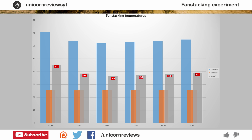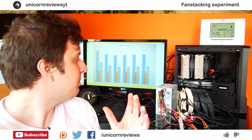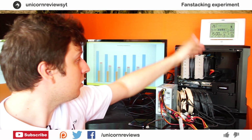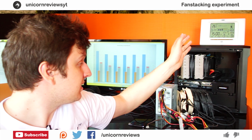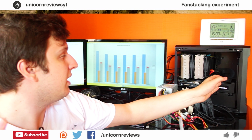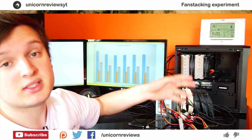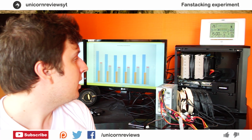I am not a doctor in aerodynamics or anything, but what I think happens is that the airflow from the first fan can't actually reach all the way to the heatsink, which is one bit. What's also a possibility is that there's too much turbulence coming from the first fan, so that the second fan can't do its job properly, and the third fan is completely screwed. I think that's what might be happening here.